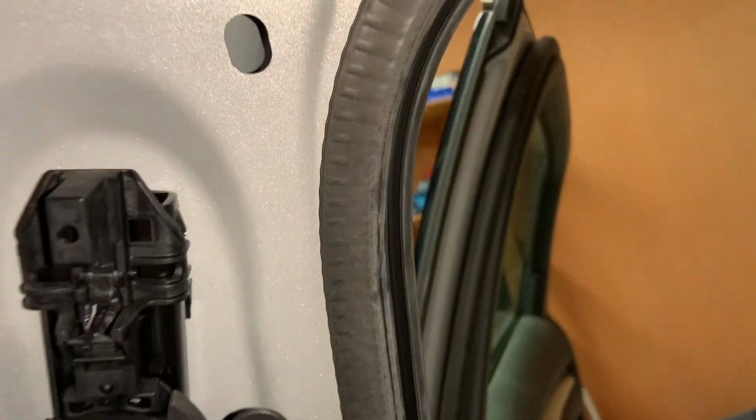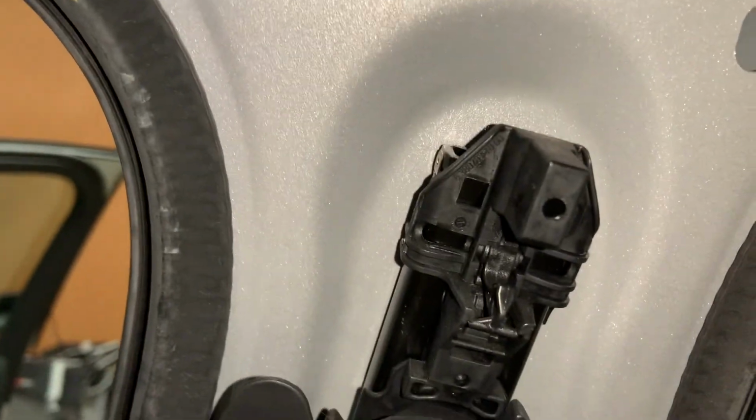The seat belt, I'll let the seat belt stay attached. That's just easier, otherwise we'll have to remove more trims in order to remove the seat belt from the trim. And I don't have to remove the trim, only the headliner. Just remove the airbag tab, and it's a long tab all the way inserted into the plastic part and also the metal frame.